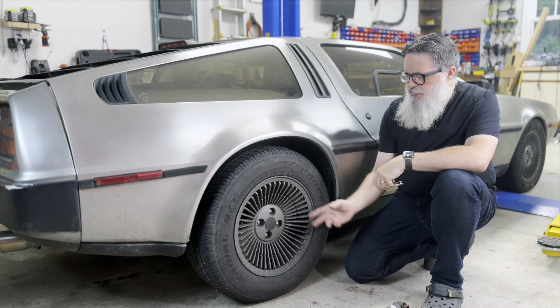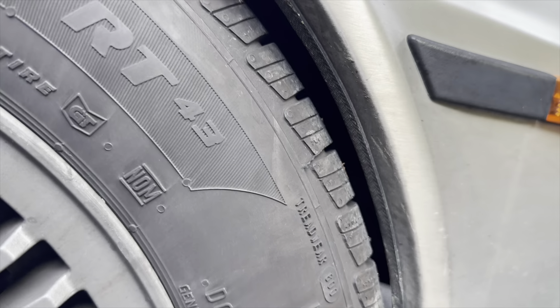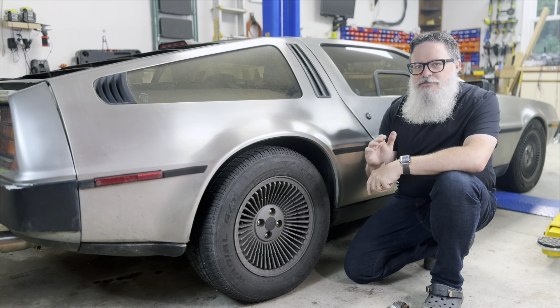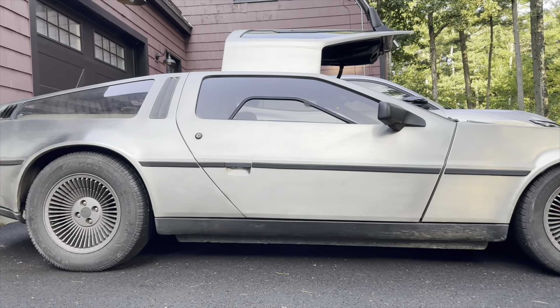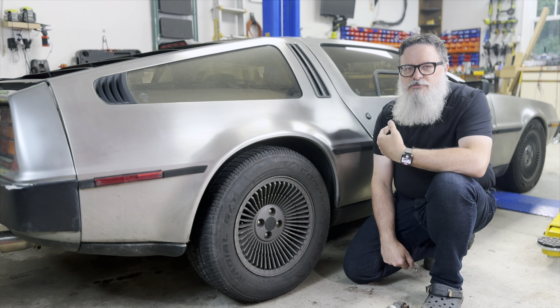Before DCS, I'd replaced my shocks with KW coilovers and set the ride height to about where the old shocks were. But by the time we made it to our first stop, the suspension had settled quite a bit. My front tires were likely rubbing against the fenders when turning, though I didn't notice any problems while driving. Putting the car on a lift and lowering it again seemed to temporarily reset the height, but only until the next drive. I fixed it by raising the coilovers another inch — it still rides low, but clears the fenders enough not to scrape in corners. I found it easier to adjust ride height after loosening the nut on top of the shock, so I wasn't fighting the spring as much while turning the wrench.